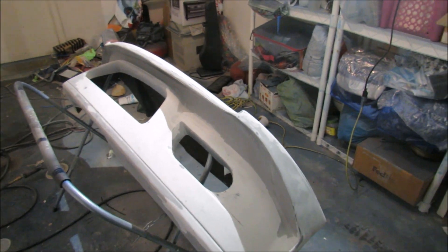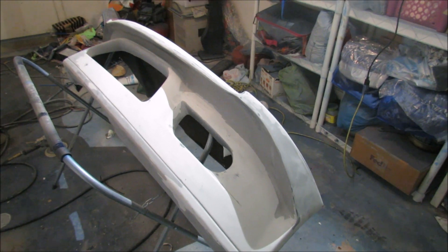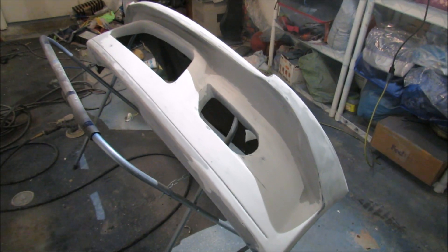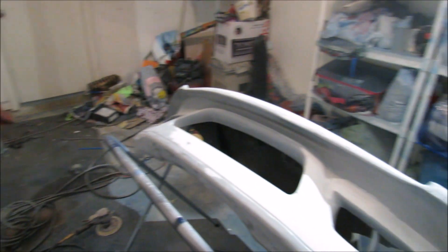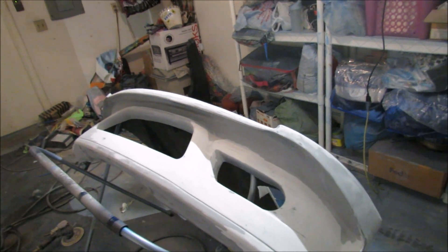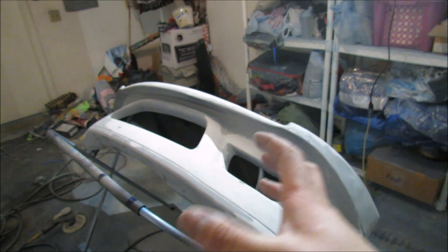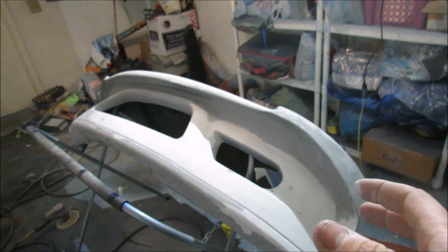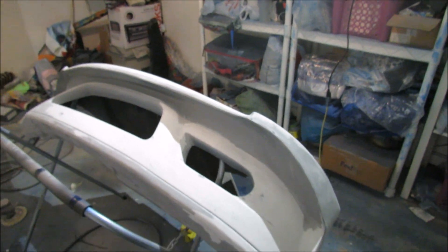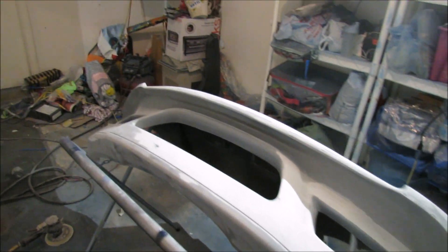That's going to be it for today — I'll throw three or four really good thick layers of primer, and then maybe tonight I'll get around to sanding the primer, but definitely tomorrow I'll actually paint the silver. I decided not to do the side mirrors yet, because I want to do the side mirrors, side badges, and the side end plates of the wing all in silver together. I'll just wait for the wing to get here to do all those smaller pieces, and for now just focus on the front bumper.